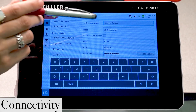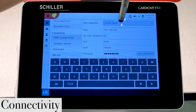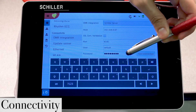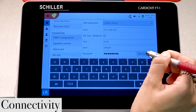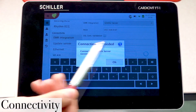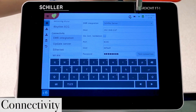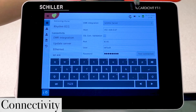You have fields that populate: your Host ID must contain the IP address of the PC that the reports are going to be transmitted to. Your port will automatically fill in as 8181, and then you have both your user and your password — by default, user will be 'default' and the password will be 'system'. Go ahead and test your connection. You have now successfully connected to the server, and your Wi-Fi icon is now green — it went from black to green, meaning you are now connected both to the Wi-Fi network as well as the server.